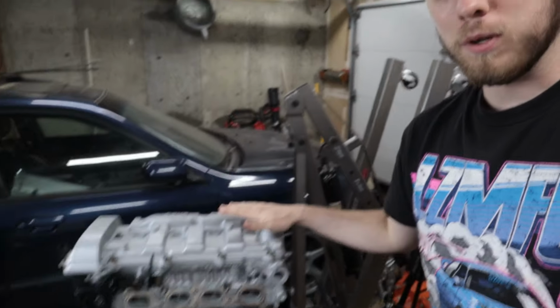We got another episode about the Protege today, and we are just jumping straight into things. I'm getting pretty excited about this build because we are getting really close to getting the engine back in. What you guys just saw was finishing up sealing off the engine. We got the oil pan, the valve cover, little random bits and pieces here and there. The next step is going to be to get the flywheel, the clutch, and the pressure plate installed onto the engine. And then after we do that, we can mate the transmission and the engine back together and hopefully drop this thing in the car pretty soon.